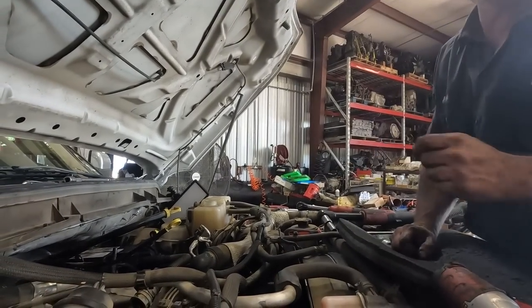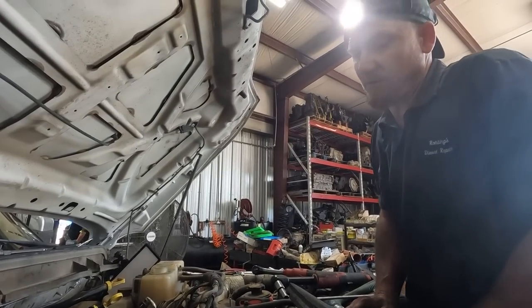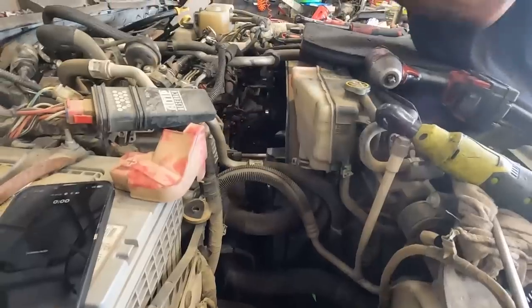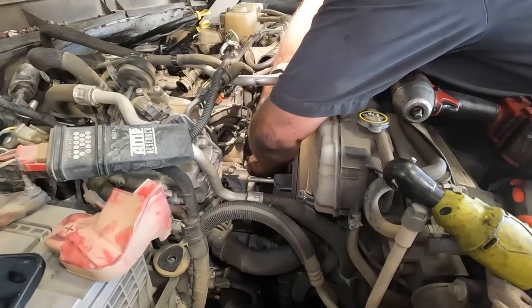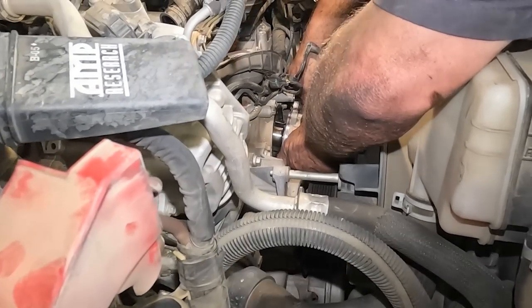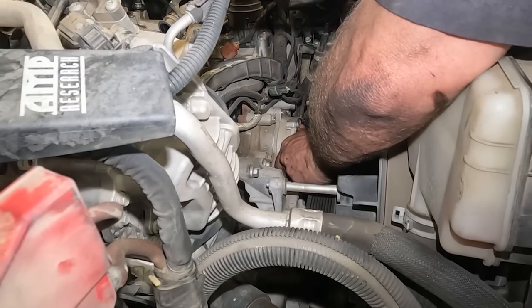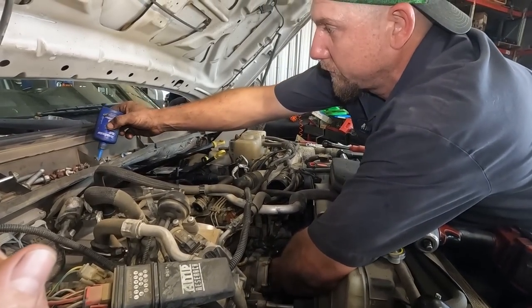Using an electric ratchet, always snug them down, I like to feel it with a ratchet and make sure it's good. Then I'm gonna get a vacuum pump gasket and put the vacuum pump back on, then the fan and all that stuff. Put it all back together - that wasn't too bad. When you already got everything apart, doing the pump isn't a big deal. It just lines up at the little notches in the front of that gear - get that little jig on him, slide her in there - and put blue Loctite on your bolts so they won't vibrate out and cause an oil leak running down the front of your motor.